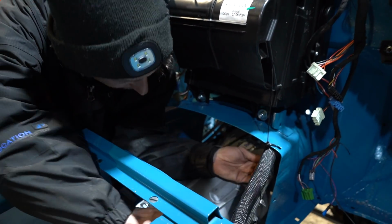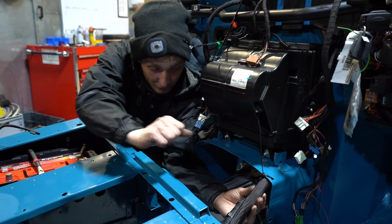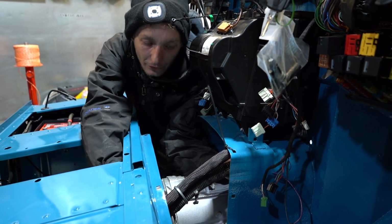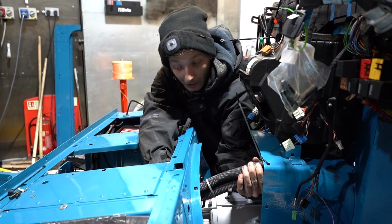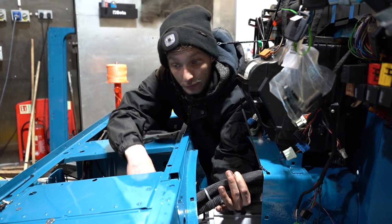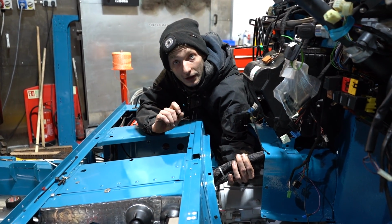You see here, there'll be a plastic shroud here for the gearbox controller, or the gear stick if you like. I've just loosely tied these up here now, so I know that's where they're going to live. Obviously they'll have proper clips on, but I need it to be there so that when I'm sizing all my boots for the strain relief as the loom comes through into this box, it's all in the right place and it's nice, neat and tidy.